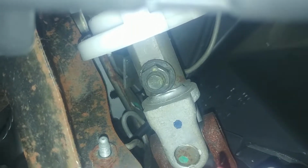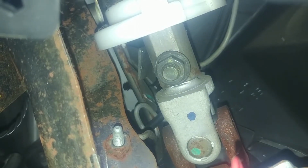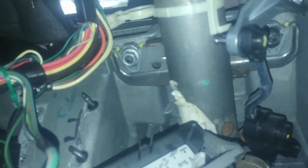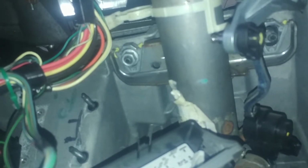And I've turned the steering column. So now the nut is pointing down, and we can disconnect that nut, 15 millimeter nut as well. I got one nut left holding the steering column up. Then once that nut and bolt are set up, or off of the shaft at the end, then we'll take that and pull the steering column out.